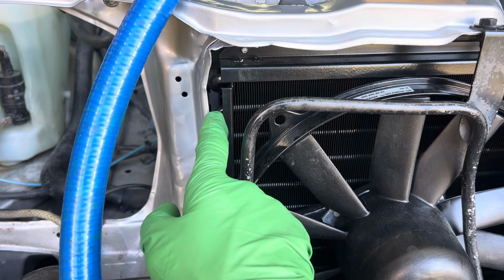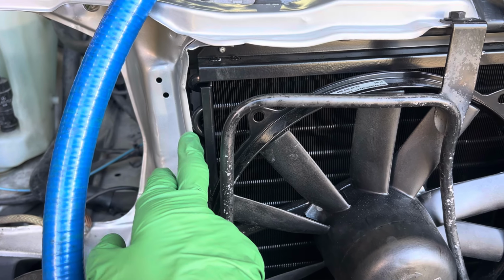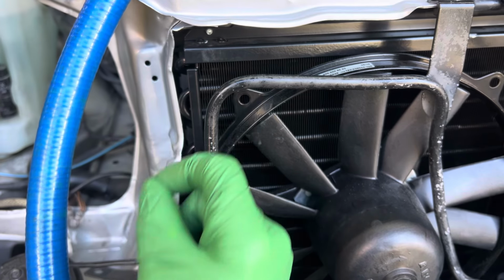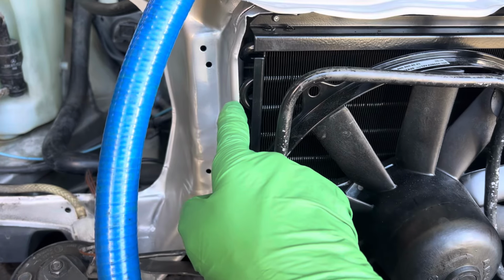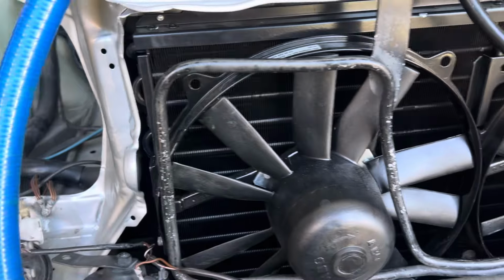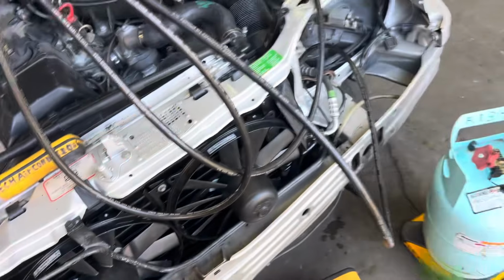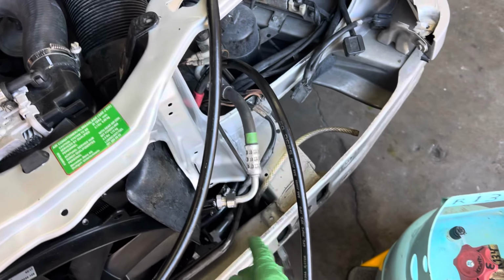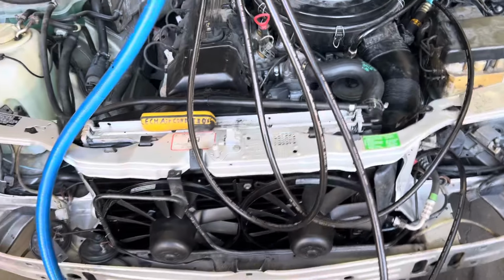this is made out of copper. And so the sheet metal is going to wear a hole here. I'll have the body guy hammer that over a little bit and make a little bit of a gap there, because where that sharp edge of the metal is pressing up against the condenser, that's going to be a leak in the future. He still has the problem where the line is stuck up kind of high, not as bad as it was before on the other aftermarket condenser.